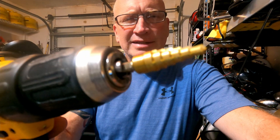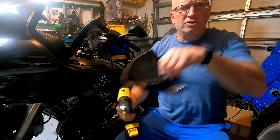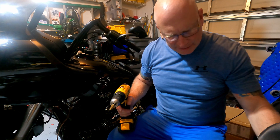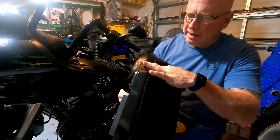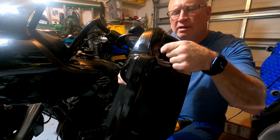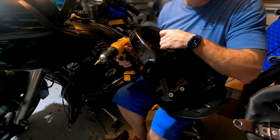So let's go put it on the bike. The first thing you want is a step-up bit if you don't have it already — you can get a set of three different sizes on Amazon for like $10. It's really easy to drill holes like we're going to drill for the speaker wires. You can do it wherever you want, but personally, you'll see a little groove in here — I drill the hole in here to run the speaker wire through. If you mess up, it's the back of it, and this is behind the speaker, so it doesn't matter.